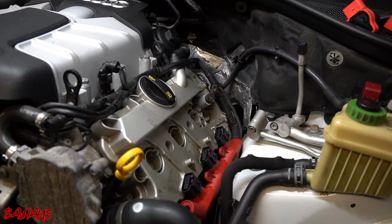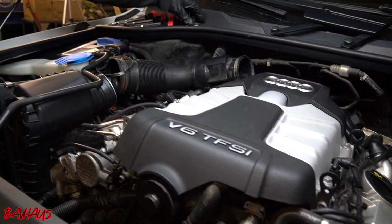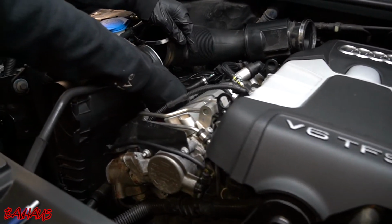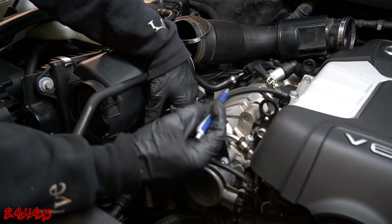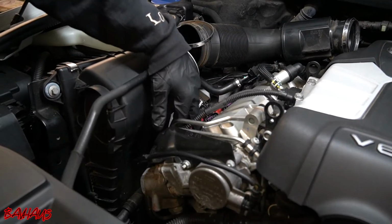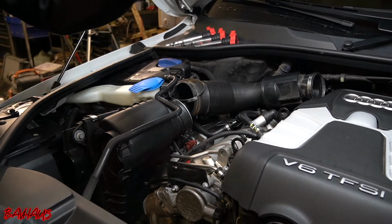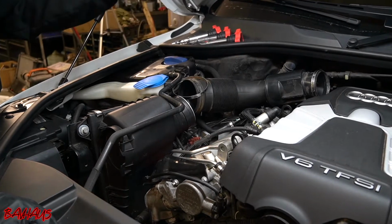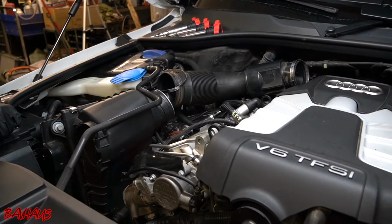Along with that, I'm going to go back to the passenger side head, and I'm gonna put back in my rear 2 spark plugs. I'm going to leave cylinder 1 out. So I'm going to get data now on a running compression test on cylinders 1, 2, and 3 separately. So I'm going to quickly retorque all of these spark plugs down and put all the coils in, and we'll link up back with you guys when that's done.